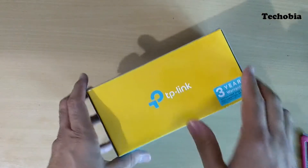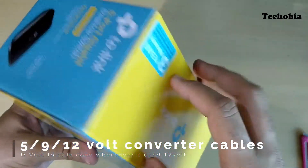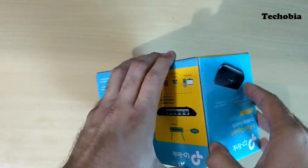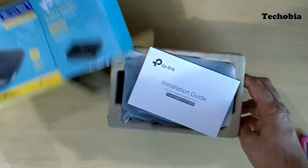As I wanted to make it more portable, I did some research and found that in the market there are 5-volt to 12-volt converters available, which you can easily purchase from eBay. I can provide you the eBay links — using those you can easily power this router from your USB port.